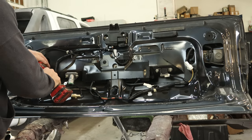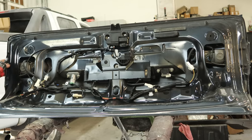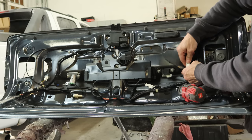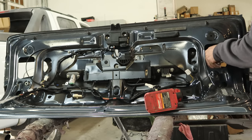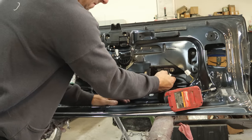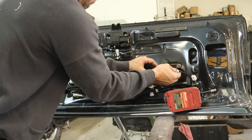Now that we're done welding, we have the grinding gnome grinding down our car — that's the noise you hear in the background. He's going to grind all of our spot welds. We're going to strip down the deck lid for our painting gnome. A little wiggle and pull and our reverse lights and parking lights come out. Do the other side, unplug it, and unbolt it. Pop it out of there. One bolt for our trunk button — we'll wiggle our button out of there. This one isn't from Texas so it's not melted, and it probably doesn't work because none of them ever do. Pull our latch off, put the lock off and put the key back in it so we can use it later.